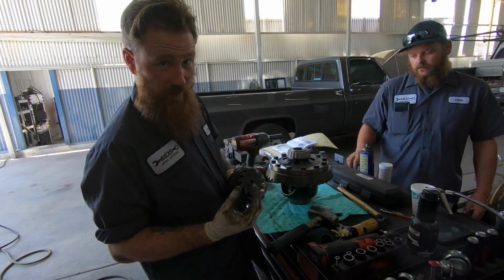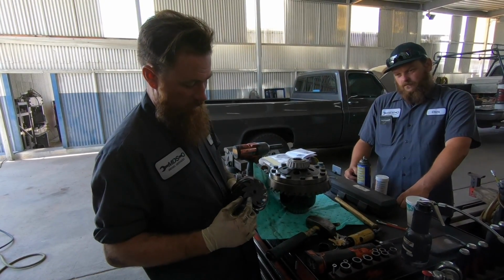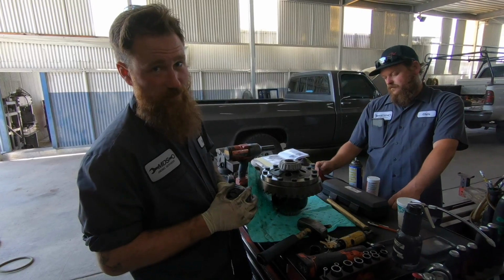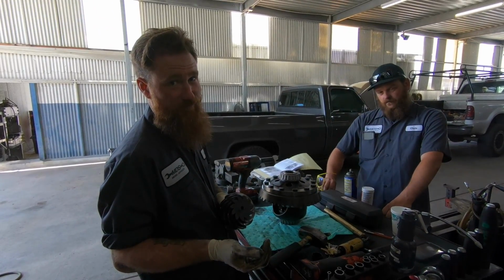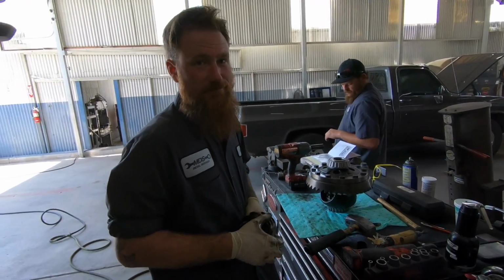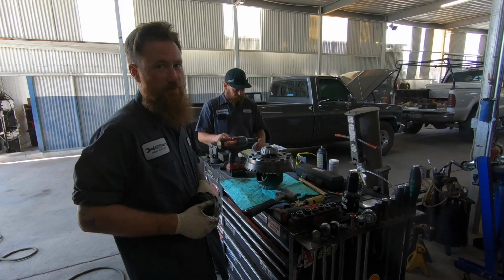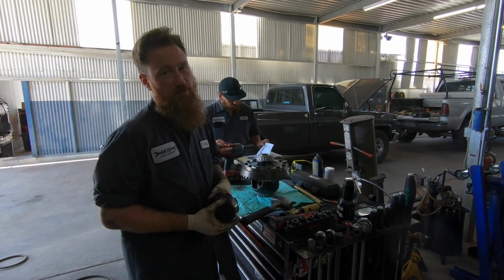So if you get super low gears, one, you're transferring a lot more torque to the ground, and two, you can actually twist the whole pinion gear clean off. Oh, shit. Potentially. So the 456s are weaker gears than the... Because there's more stress going through them. Okay, so now, higher torque load.